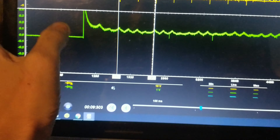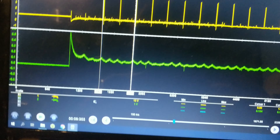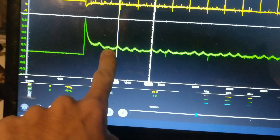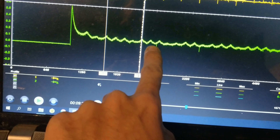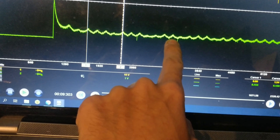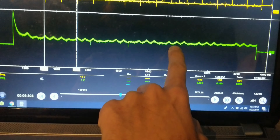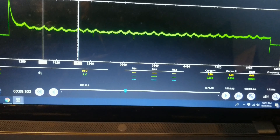Here is the capture we first took with the relative compression synced on cylinders one and four off the ignition coil control. You can see there's a fourth hump here — looks a little lower. There are four humps, then we lose one — it's low. Three good humps, then two low, two good, one bad, three humps with one looking a little low, then one bad, three humps where the middle one looks better than the outside ones.